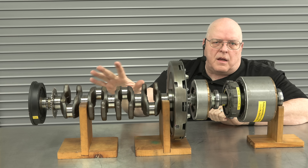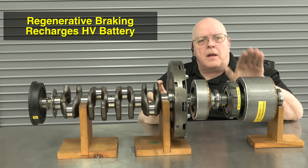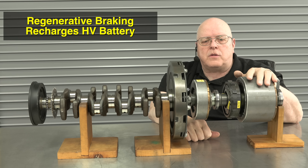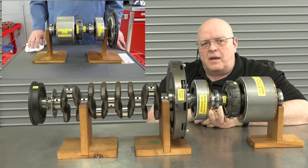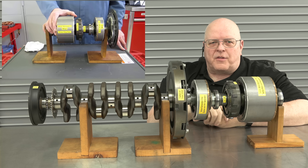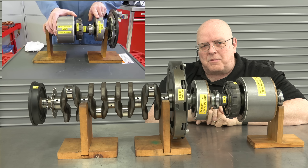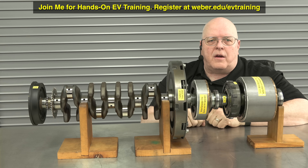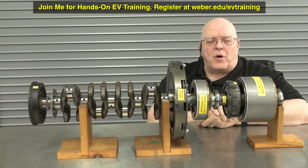This transmission has a series hybrid mode, a parallel hybrid mode, and when you decelerate, MG2 becomes a generator — making it difficult to rotate — and runs current back to the high voltage battery to charge it. This is the Toyota hybrid system that's been around since December 1997 when the original Prius came out. I shot a video on this system 15 years ago and made a couple of mistakes, so I'm redoing it to improve accuracy and to show how the crankshaft and motors are all in line to help each other drive down the road. I hope that's been helpful — thank you for watching.